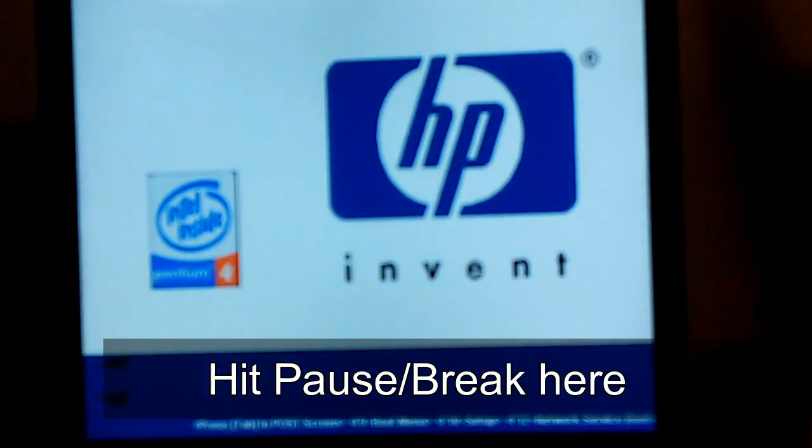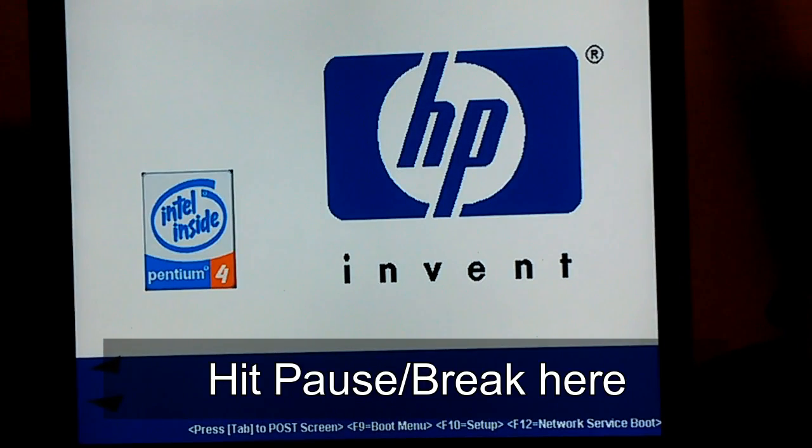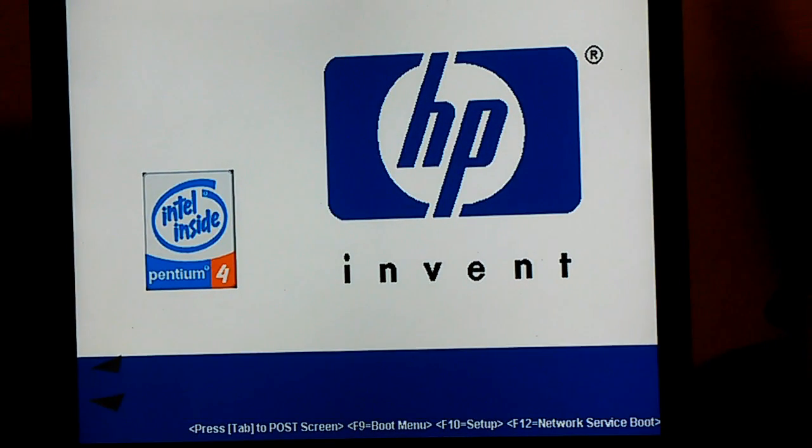Now I have inserted the bootable CD into the computer. We're going to start it up, but we want to stop it before it checks for the peripherals. Now we go ahead and start our computer, and we start it with a pause break at the first screen. I hit pause break, and that froze the computer. The computer is now on, but it hasn't checked for peripherals yet.